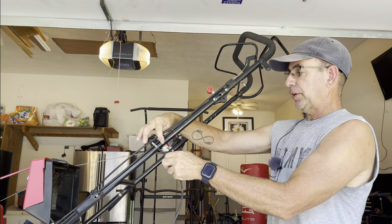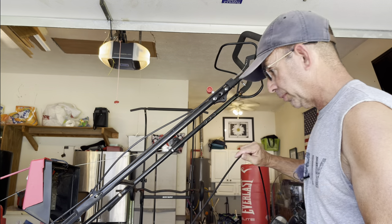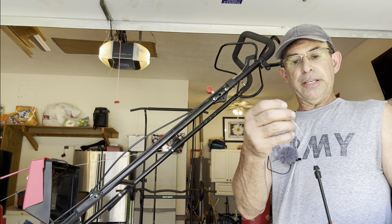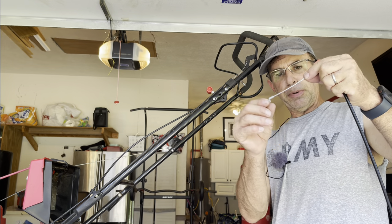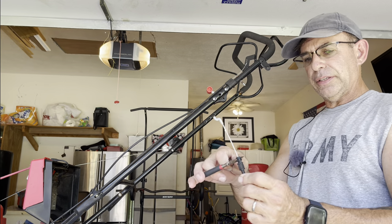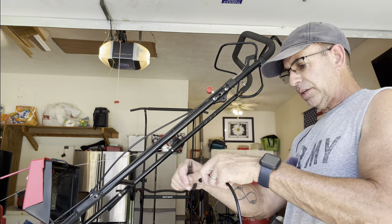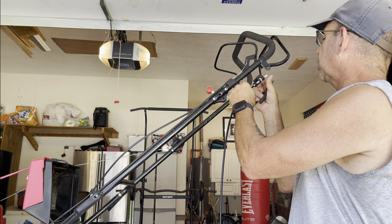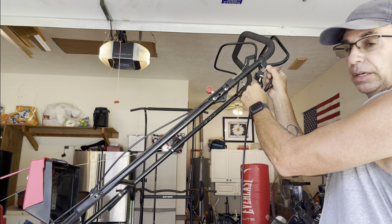We got all this part done. Now what I've got to do - off camera, because it's impossible to film - is reach in there, grab that arm of the transmission, put a little slack in it, and pop out the old one. Then I'm going to squeeze this together with my pliers and slide it out, fish the cable out, fish the new one in, pop it in, run this up, nut and bolt it just like it was originally, and put the nut and bolt in right here, and his mower's ready to go.